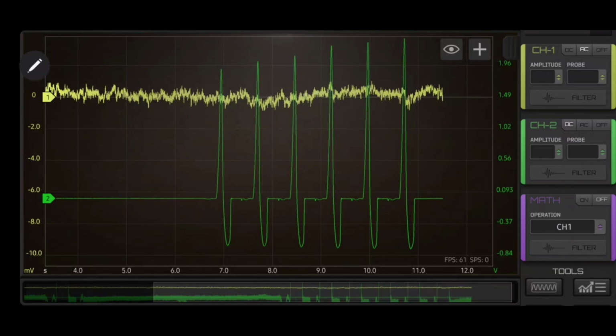So I thought that was cool to show you guys that I actually did this on an engine sitting on the floor. The starter actually bolted to the engine, thankfully, on this one, and not the transmission, so he was able to do it on the floor. Just hook a battery to it, threw that in the cylinder, cranked it over, and then recorded this waveform. So I thought I would just share that with you guys.